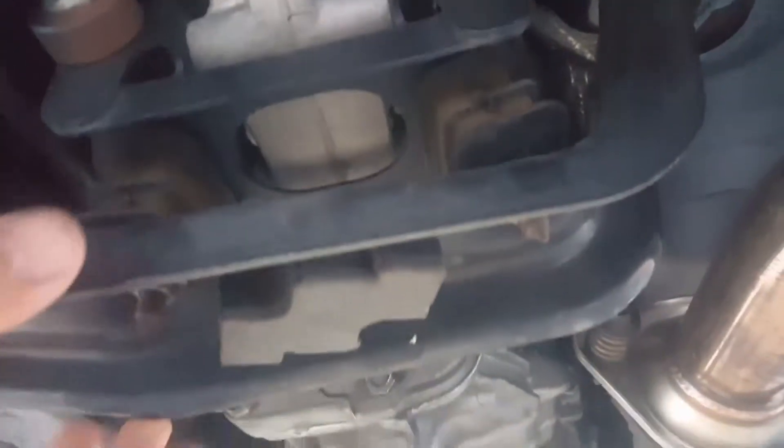The car is still the original silver color on the body, but all the undercarriage is now undercoated. You should not undercoat any moving parts — so the driveshaft, don't undercoat that. I undercoated the heat shield but not directly underneath by the driveshaft because there wasn't enough space to spray in there. I also left some tubing — I'm not sure if it's brake line or fuel line — I left that untouched.